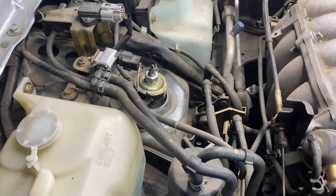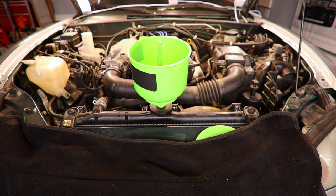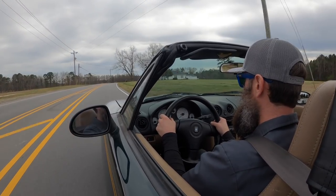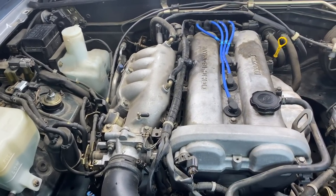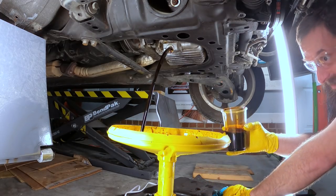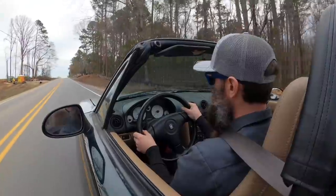Once all that maintenance is wrapped up, go ahead and do another visual inspection — make sure you put all the caps back on everything we took off: oil, brake fluid, clutch fluid, and reinstall the air filter properly. After doing all this maintenance, I like to let the car idle for a little while, then come back and look for any leaks. Then it's time for my favorite part — take her on a test drive and see how she performs. You really don't notice a difference in the way the car drives from fluid changes unless there was a problem. Then I'll park it, let it sit overnight, and come back the next day to recheck all the fluids, especially the coolant, to make sure all the air bubbles are out. Be sure to properly handle the old fluids — you can take the oils to your local Advanced Auto Parts and they'll recycle it for you.